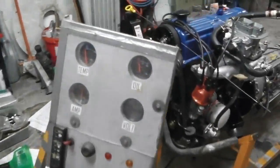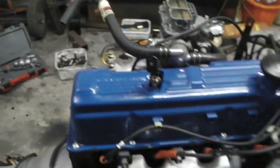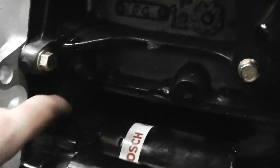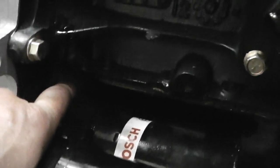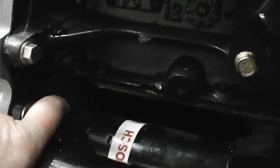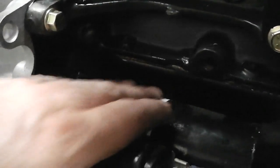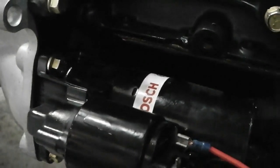Okay, yeah, so a double welcome for 35. The intro there. I'm straight in, so I'll tell you what I've just done. Just before the camera started to roll, we put on the starter motor after checking all the torque settings on the flywheel, and then connecting up the torque converter to the flex plate with the four bolts. We've turned that, rotated it around, and locked them on, so that's all in. Now we can put the starter motor in.